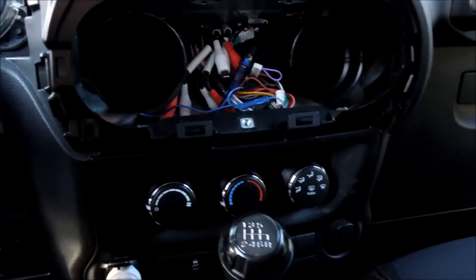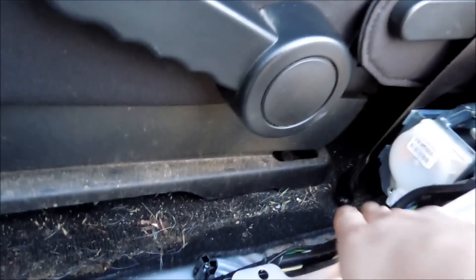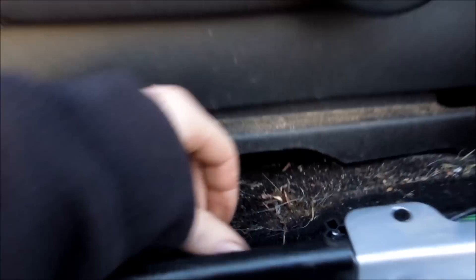I thought I'd quickly show you how I did the RCA and remote wire through here. You have this nice opening which goes right through — you can see my fingers there. I fed the RCA right through there over to here with the remote wire, same track, tied it in here, and plugged in the RCA. From here — same spot — you just push it right down and it falls down through here. I have both my wires right here; I'm just gonna tie them up behind there and they're hidden. Same as the other side — pop it all out and tuck it along the carpet, take the lower road, don't get it under your seat belt.